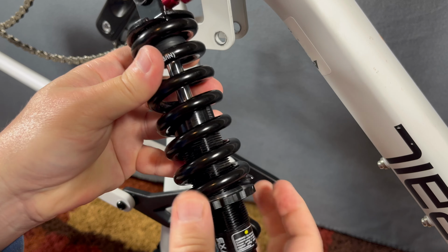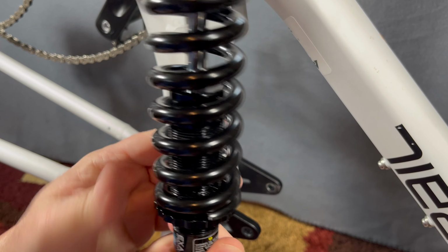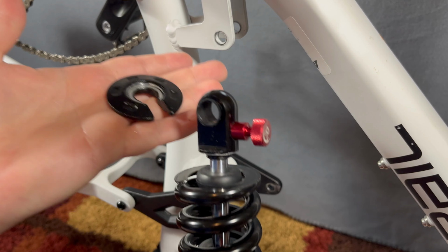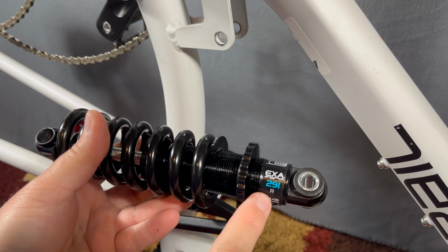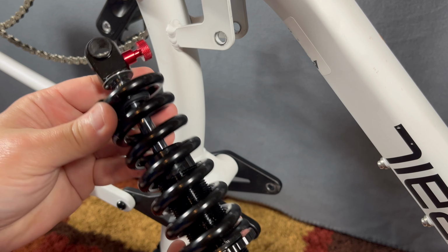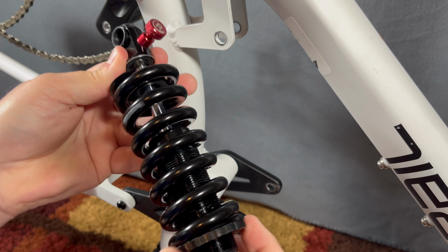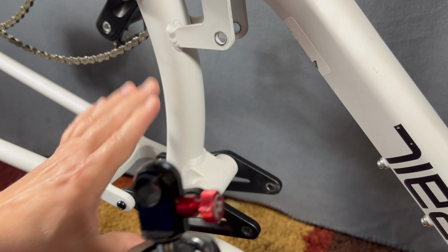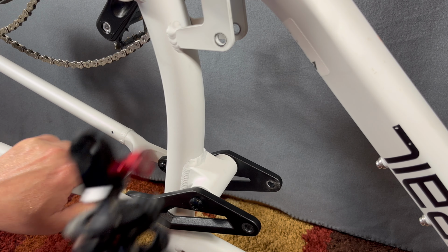Now, obviously, I could loosen it down to where it's not functional. And at that point, yeah, I can get close to the 48 millimeters of travel, but things fall out. It's just not usable. And that's not a problem with this shock. This is still a decent shock for this system because it's not a pogo stick. In all my years of budget mountain bikes, there's a lot of pogo stick shocks. This is not one, and it tensions well enough, has a rebound adjustment that I've shown works. Saw that in slow motion, and I know that this pivot system works.